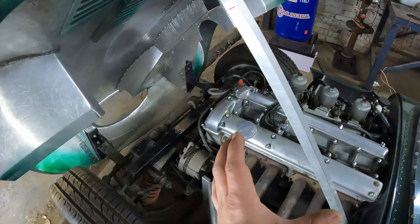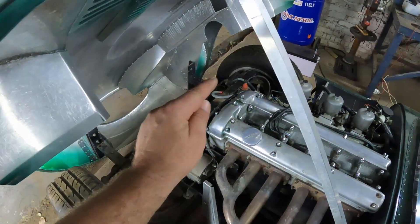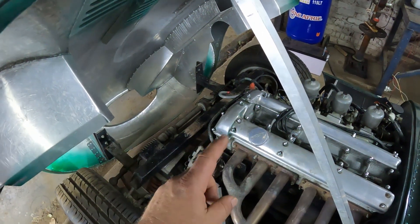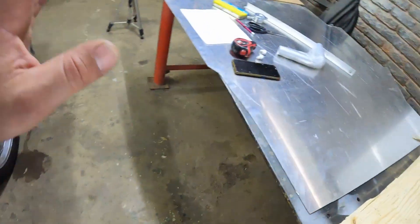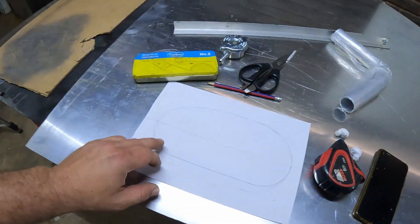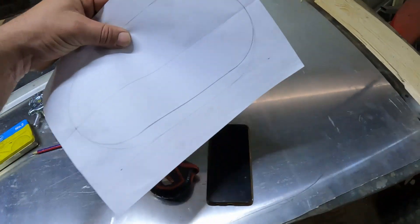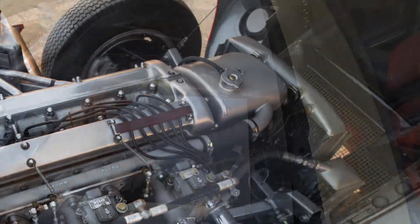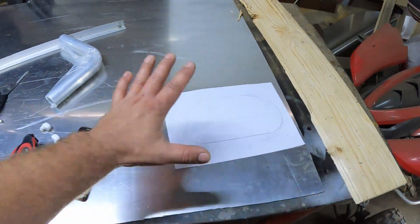The original expansion tank actually makes the engine look about eight inches or so longer, so I thought I would try my hand at making an aluminium expansion tank that's going to sit there in the front of this engine so it'll look very much like the original. What I'm going to do is use this three millimeter piece of aluminium plate — I drew out a profile of what I think the end caps should look like, very much the same as the original. I'll show you some pictures of what the original reservoir tank looks like.